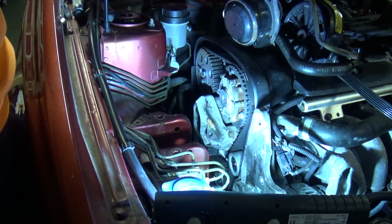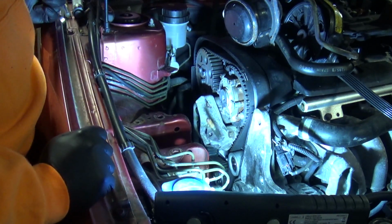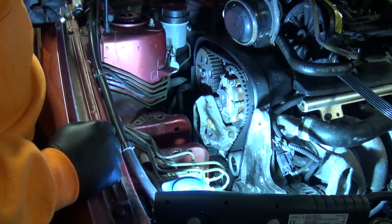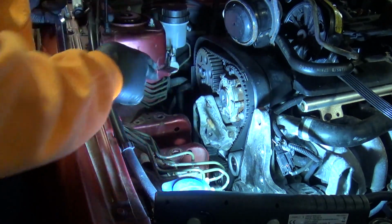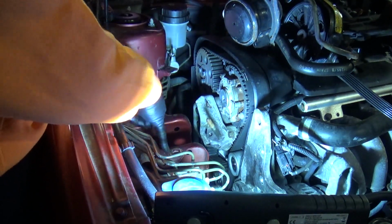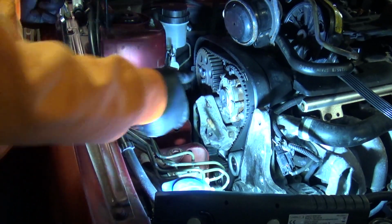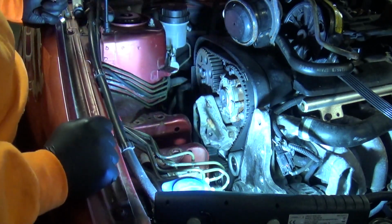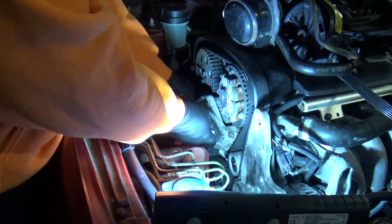I'm not able to find torque settings for the engine bracket. How to say this? Tight, because it's an engine mount, but paying particular attention to the bolts going into the engine, and those 3 there, not overly tight because you're screwing into aluminium. Those bolt holes there will be a bit more forgiving, but again, it only looks like sort of like a captive nut that's been welded on, so don't go like full gorilla on it.